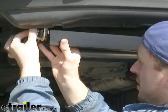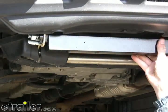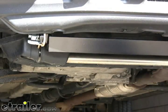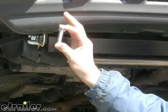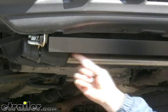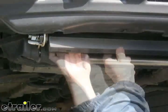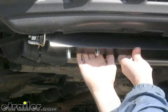We're going to repeat that setup for the other side of the vehicle. We want to leave these carriage bolts loose for the time being so that the main cross brace can pivot back and forth until we get the main receiver tubes in place. From there, we're going to take our half-inch hardware — the hex bolts — and insert them from the inside of the cross brace down through the holes in the bottom, at four hole locations.